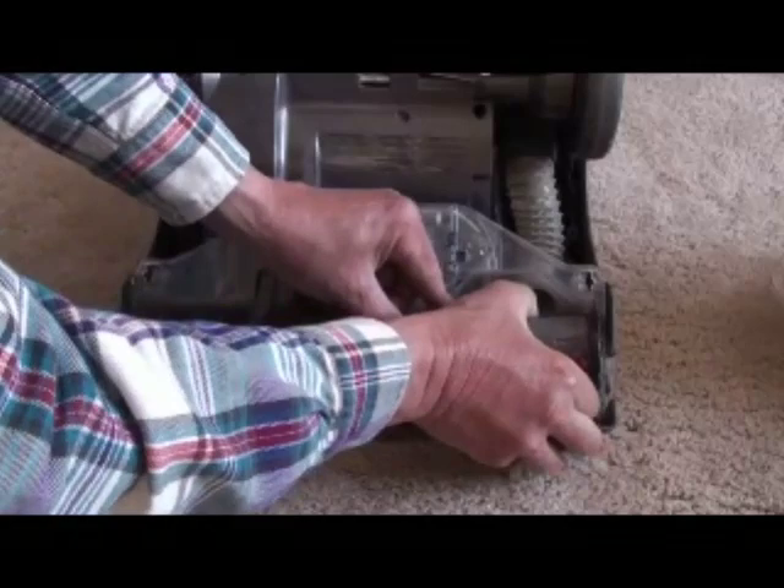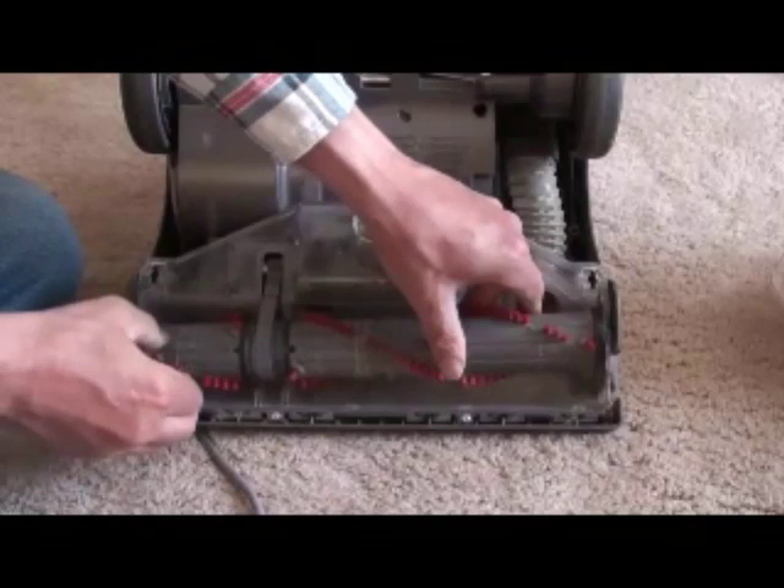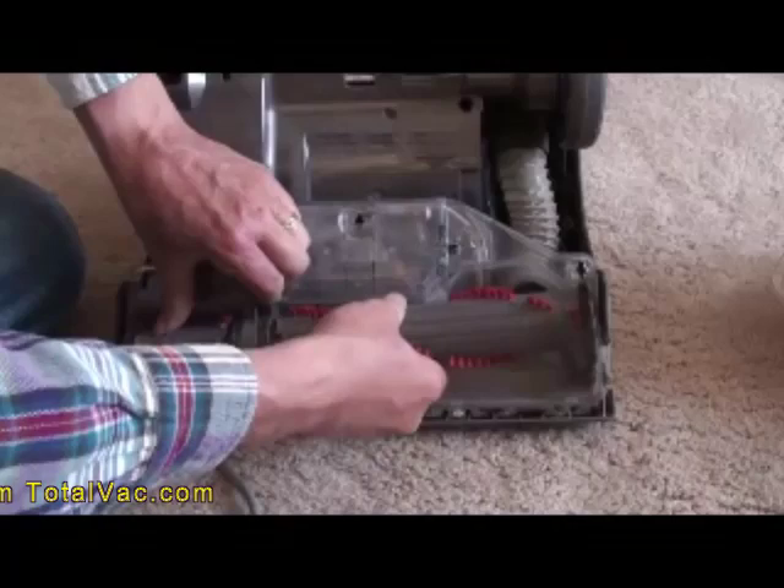It's a toothed belt. In this case my vacuum cleaner is not working — the belt was completely frozen up, and when I got it to move it made a horrible rattling sound like it was going to fall apart. Basically, the belt and that plastic cover you took off is what holds the beater bar in place.